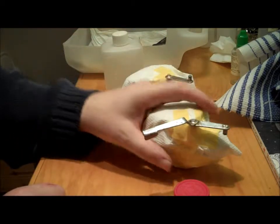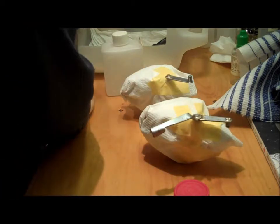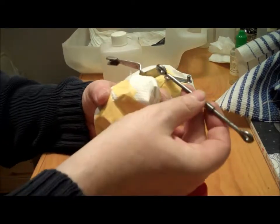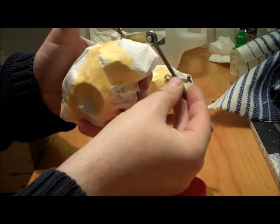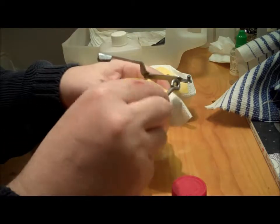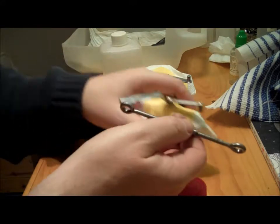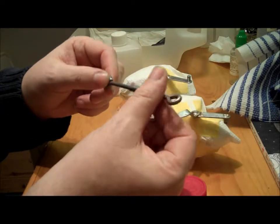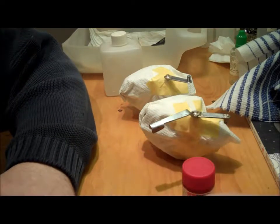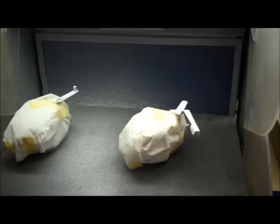And what I might also do is just on the little stub here where the adjustment rod goes on. So this is the rod, and it attaches to there, and then obviously this one lever then activates both choke levers, and I might actually put a little bit of heat shrink around that just to make a nice surface and reduce some of the wear and tear. So yeah, so I'll get this mixed up and warmed up. We'll then surface prime it and go from there.